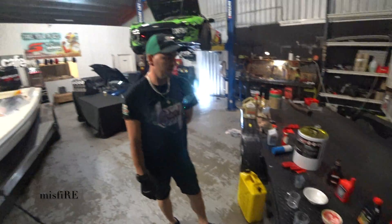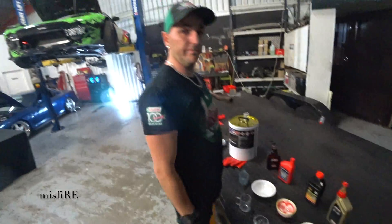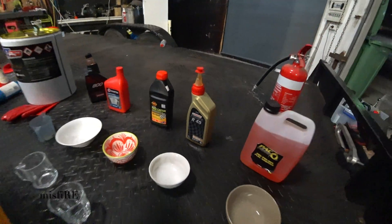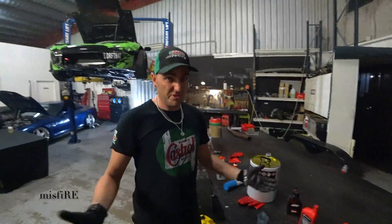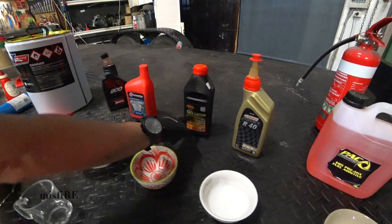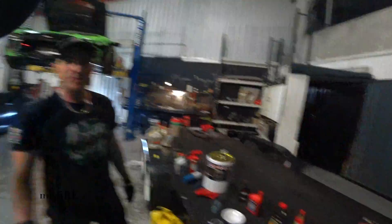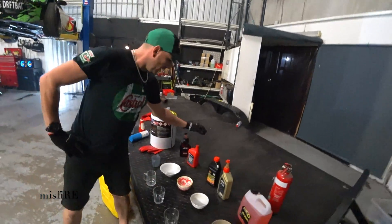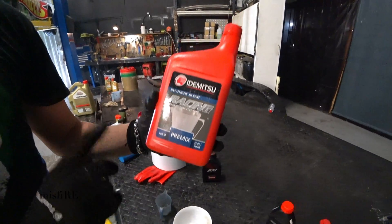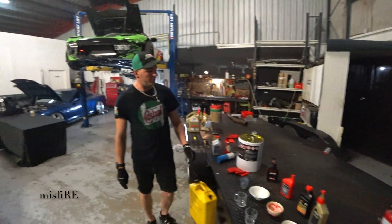We've got all the main products here. First, there's the Pack Performance E85 pre-mix fuel additive — they know their stuff, so you'd hope the pre-mix is pretty good. Then we've got the very famous Castrol R40 — a full castor-based oil, and my personal pick that I use. Then there's Penrite, which is also a castor oil but it's a castor synthetic — I've always steered away from synthetics. And then Idemitsu, which I used to import, so I know a bit about it. This is a synthetic, and it would have been the only synthetic oil I'd ever tell you to put in a rotary — purely designed for rotaries. We're going to see how it mixes up and how it burns.